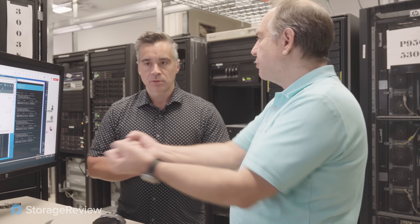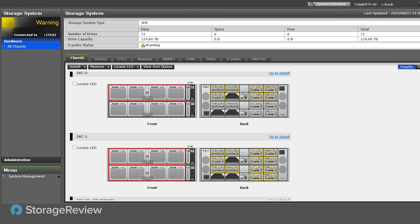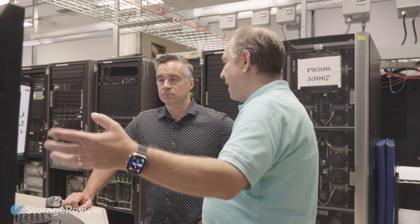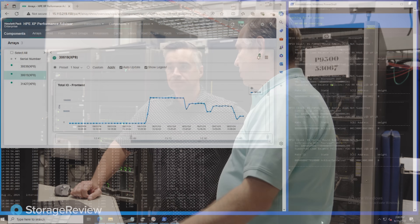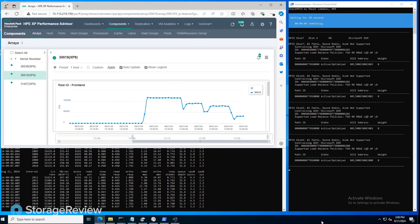You can gracefully turn a controller off rather than yanking it — take it out of commission and put a new module in. There are some steps like firmware upgrades to get everything on the same level, but you can do this in full production. We've now failed the third controller — it's red and generally unhappy, but still operating. All three pulled controllers show red, and the last remaining one is still active. We've reduced controller performance by 75% — down to 25% capacity — and we're still up and running with extremely high bandwidth to all the data on the drives.